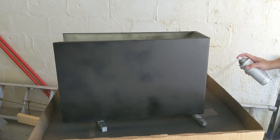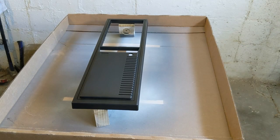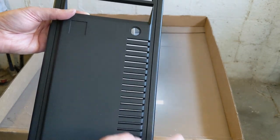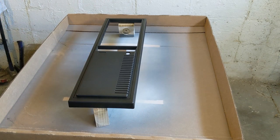When working with metal it is often the case that you get a blotchy pattern. The only way to address it is to wait two or three days, sand it, and try painting it again. Though I've generally found that I actually kind of like it on older cases — it looks a little textured and it doesn't really bother me, so I think that comes down to personal preference. The front of the Tower of Doom case turned out really well: nice and even, good coverage. It is quite textured since a lot of cases have air intakes, so make sure you're going at it from a variety of different angles with your spray can for good coverage.